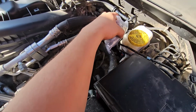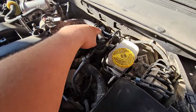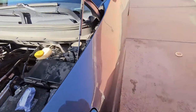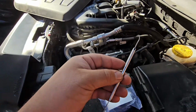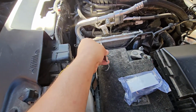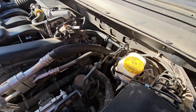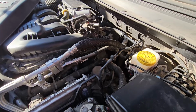It's very simple. Put a bag over the main line. On the other side, you're gonna remove the gaskets on this main line on the expansion valve side, and when you get to the other side, you're going to get a scribe, and you're going to gently pick at the O-rings or at the gaskets, right behind them. Simple, self-explanatory, but anyways, replace all that stuff and put it back in reverse order.